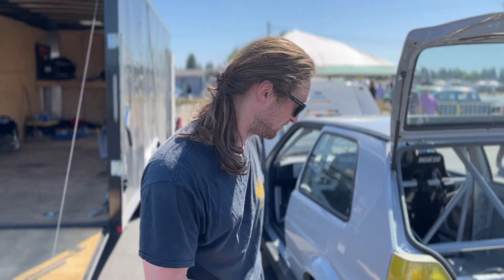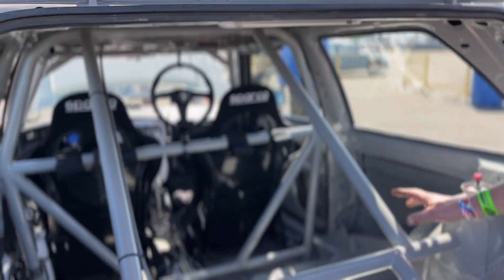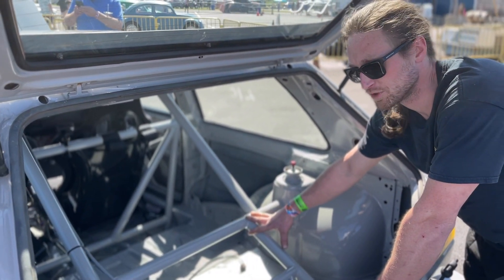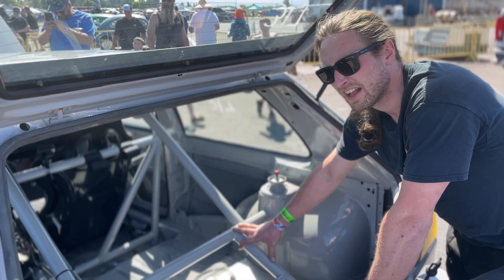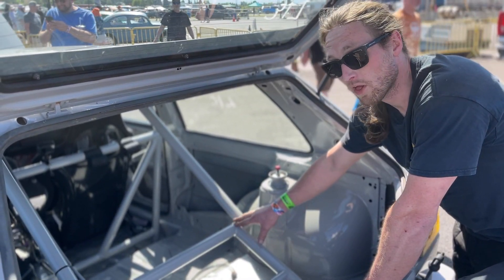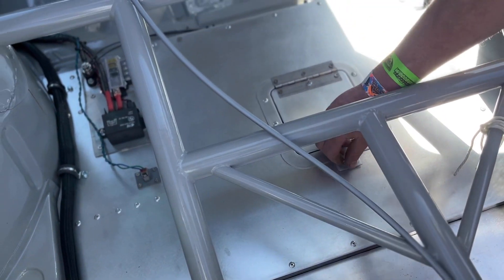Made some nice changes over the winter — got the parachute on there, so now you have a full parachute. To do that, he had to reconfigure the whole back of the cage. He cut out the whole back half of the cage and redid it all in chromoly to save weight — chromoly is almost half the weight of steel. He lost an overall of about 40 pounds just from the cage, though it would have been more since he also added a whole subframe for the fuel cell.